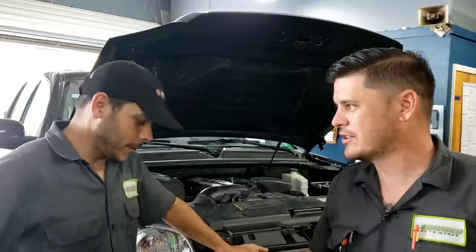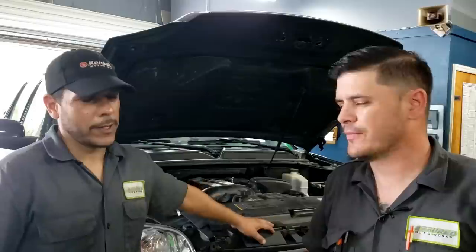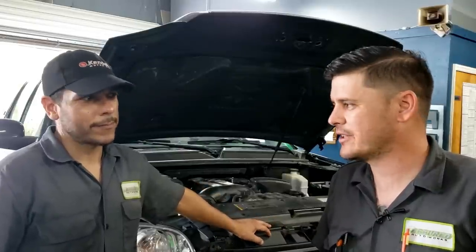Yeah. So you got the scope out and you looked at trigger for six. You looked at current for all four cylinders on that bank, which is injectors and ignition, right? Correct. And you used a secondary lead to look at six, and you weren't seeing anything, right? Right. So you moved it to other ones, and you were seeing the secondary lead waveform on the other cylinders, but you weren't seeing it for six, which is the cylinder that's misfiring, causing the run rough condition.